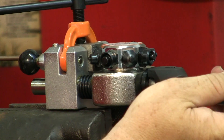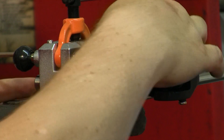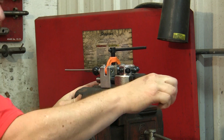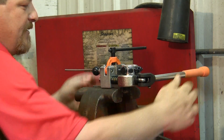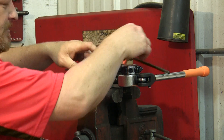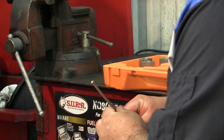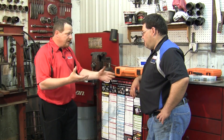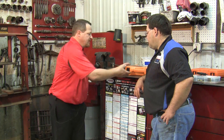The high-speed Super Duty flaring tool is for off-the-car flaring with cam lever operation for speed, efficiency, and perfect flares every time. A single flare OE grade flare takes about 10 seconds. It seats in a vise, and we also make an FT351M mount so you can mount to your bench anywhere without tying up the vise. When put away, it's a nice low-profile piece.